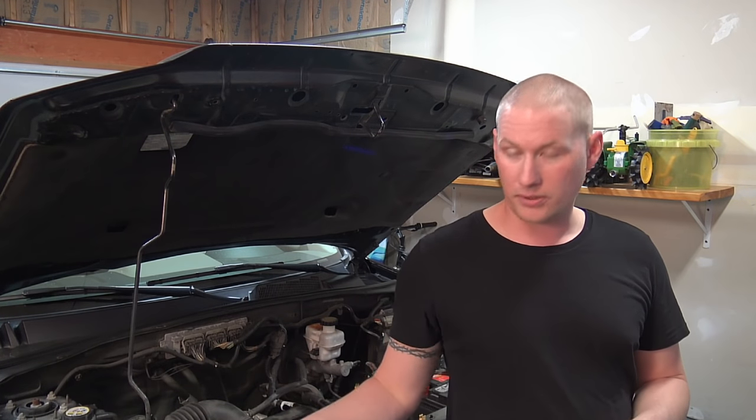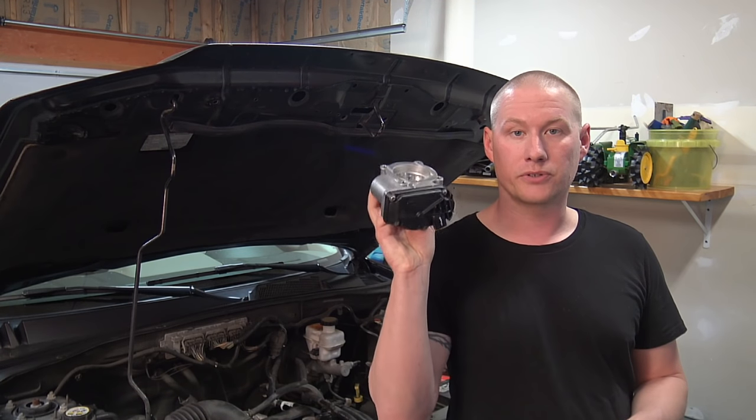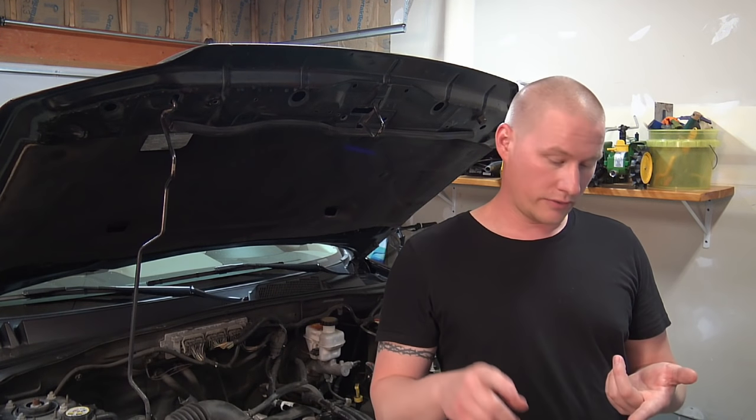If you're doing any other repairs where you disconnect the battery and those values get reset, you want to clean the electronic throttle body before this reset and relearn procedure takes place — that's very important for idle values. If you are cleaning your throttle body, follow my video linked below on how to do it properly and safely. These electronic throttle bodies with their motors and gear reduction are very strong and can get dangerous fast — there's actually a chance of injury if not done correctly.